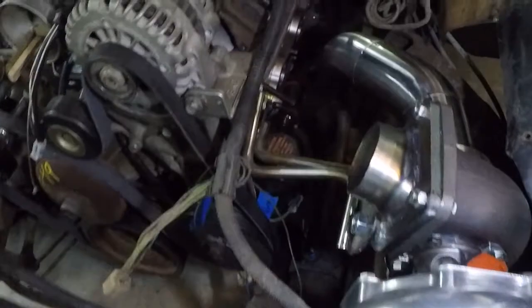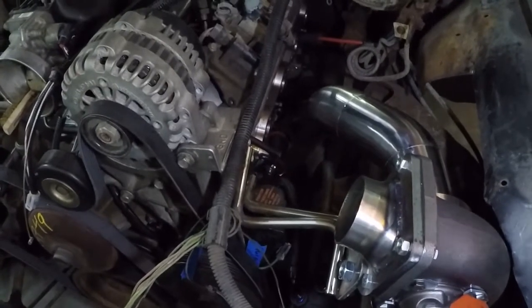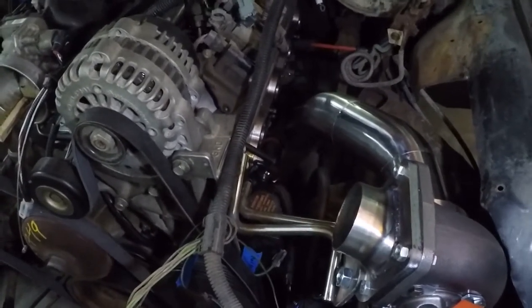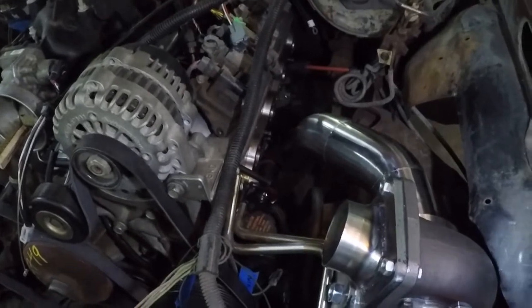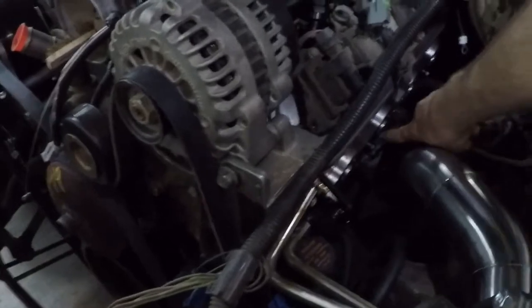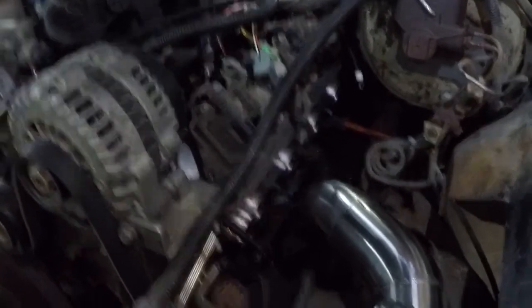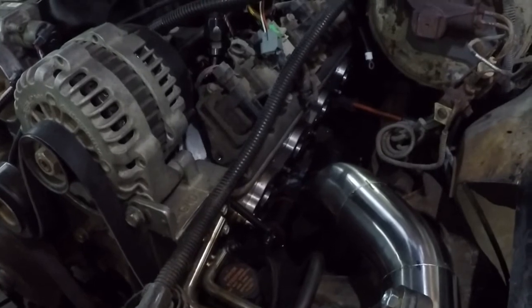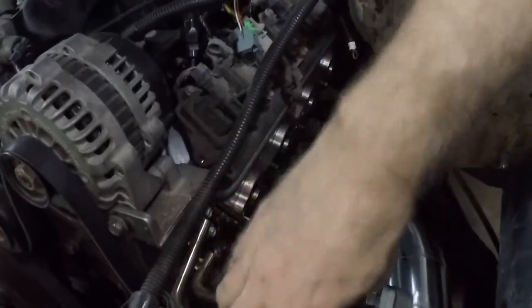What we'll do next — now that the downpipe's all tacked up — is I'll basically run the primary pipe. It's going to be essentially a log manifold, I guess. I'll run the primary pipe through there and weld that pipe with some rods or angle iron to the flange. So basically I'll have a tube welded to the flange, then I'll take that flange and tube off, cut the one-and-three-quarter-inch pipes, fish-mouth and cope them out so they go up to the upper pipe, put a wastegate on, and be done.